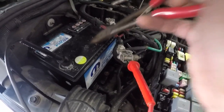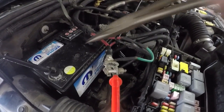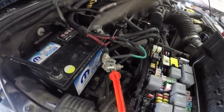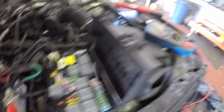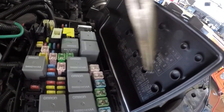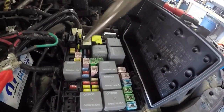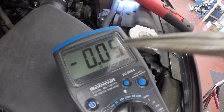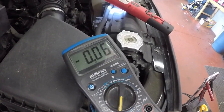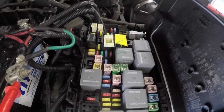It is the original battery to the Jeep — about six or seven years old on a 2012 Jeep. I did charge it and it's looking okay now. In a parasitic draw test you would remove fuses one by one, determine which circuit causes the amperage to drop on the diagram, and that tells you what circuit is drawing power from the battery. In this case nothing is really drawing anything — the vehicle is locked, the CAN bus system has been shut down.